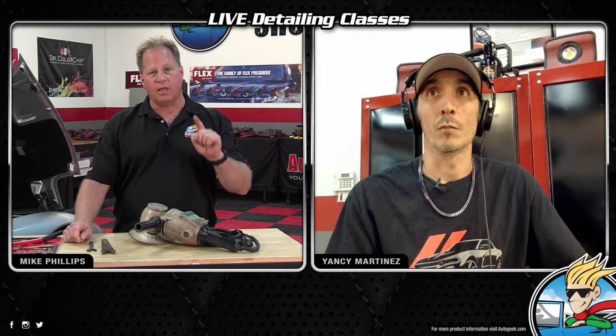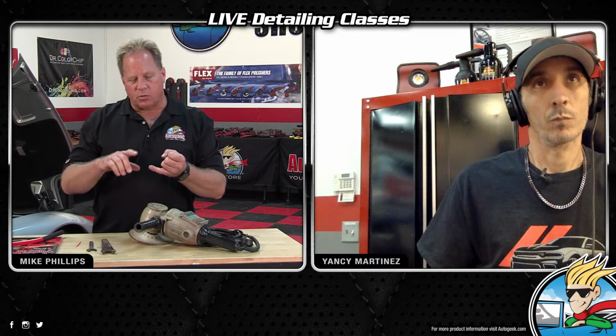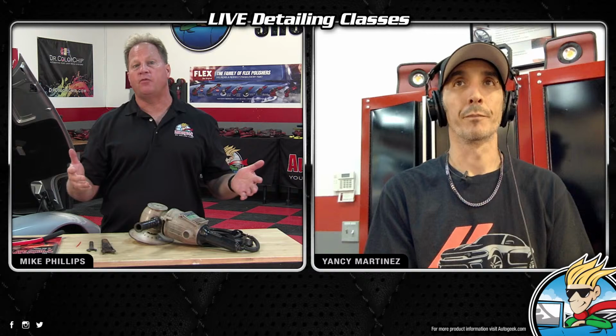Here's the deal. Sometimes, especially with classics, cars are going to have scratches in the glass. First of all, getting an original windshield may be impossible, very difficult, or very expensive. So that's a reason to try to polish the glass. The other reason is that when you pull that glass out, you're going to find rust. And now you've turned replacing a windshield into a rotisserie, body-off, five-year full restoration. Your wife's going to kill you, and it's going to cost a lot of money. So instead, polish the glass.